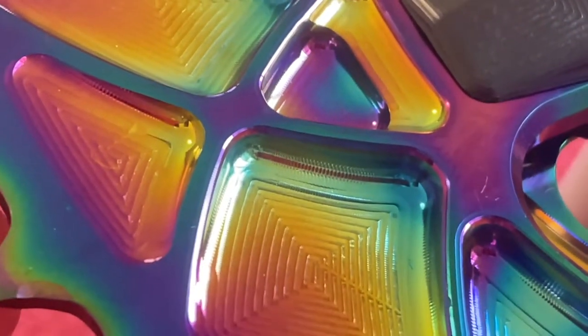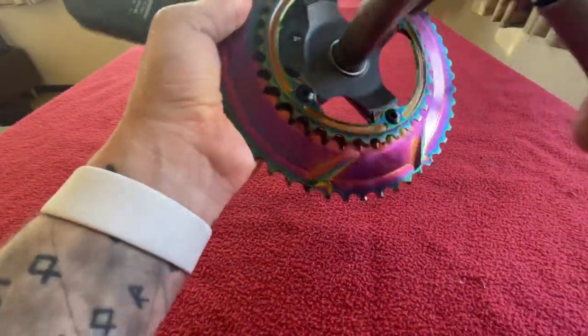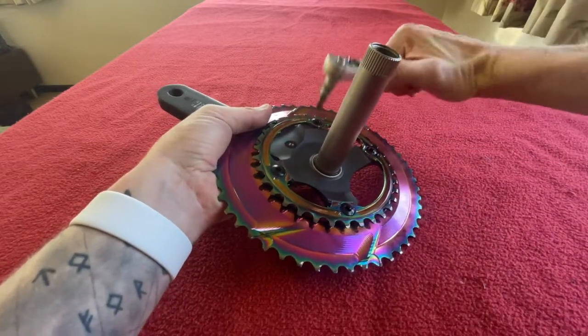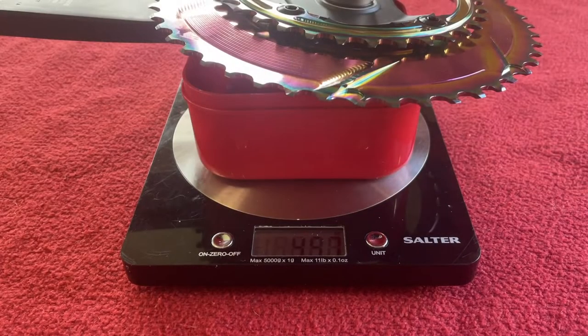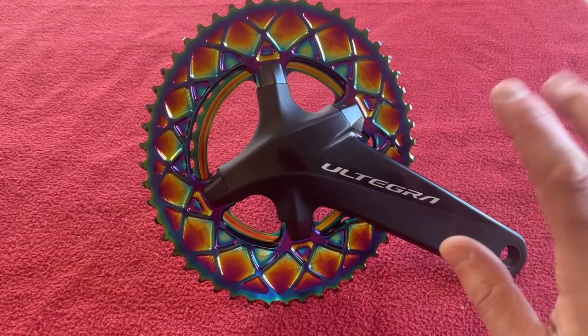You can see that wonderful colour on the rings — it's superb, it just looks great. So we've got to tighten it up to six newton meters. Just do it diagonally, and then check them again. That is it finished — the road bolt covers are on. Let's weigh it up: the right-hand crank with the two rings is 497 grams. Thanks for watching and we'll see you on the next Karo's House.